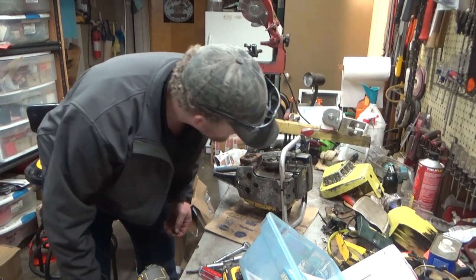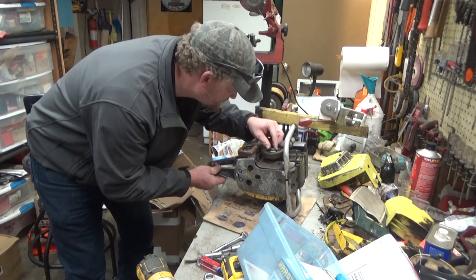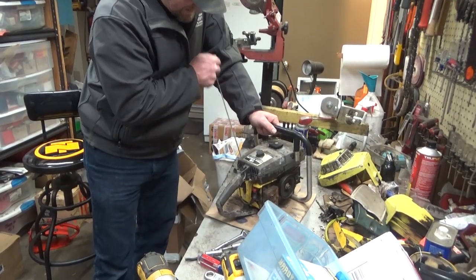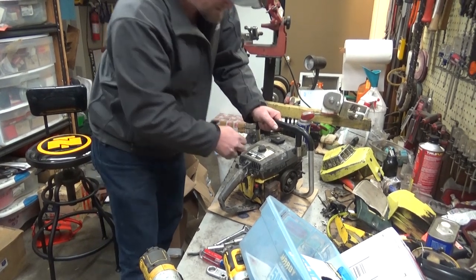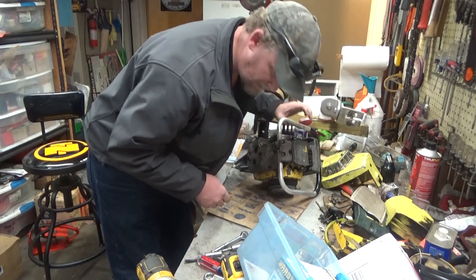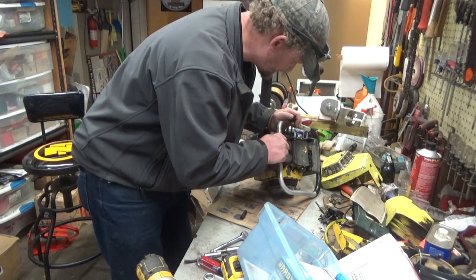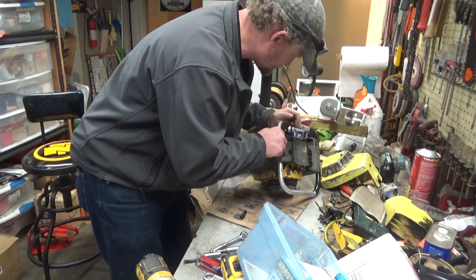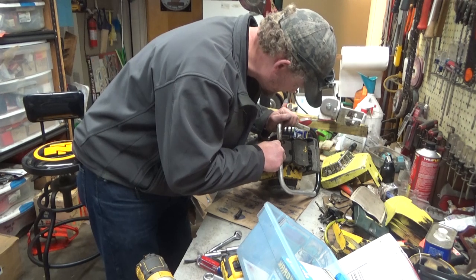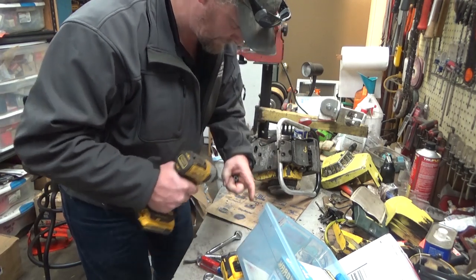let's see. What is it gonna take? Yeah, I'm wondering if it has a bad crank bearing because that squeak isn't coming from the sprocket. Sounds terrible. Alright, bear with me. I've never taken one of these vibration-isolated McCullochs apart. Oh, like this. Hell, even on Jim's, I think I was able to just take the handle loose at the tank and slip that whole thing out. Okay. We'll just see how far we can get before my phone blows up.